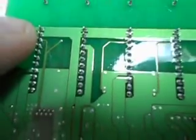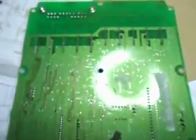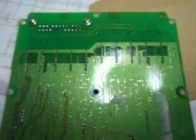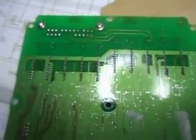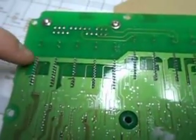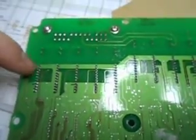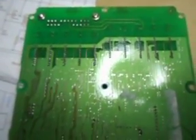That's a relatively easy point to connect on, so that's a possibility. Anyway, research continuing and I'll try and post some more information later on. I'm going to plug this board into a test unit and put a variable voltage supply on the first voltage tap and just measure what we're getting out of this point here, and see how the BCM responds and if there's any correlation.